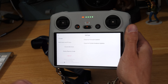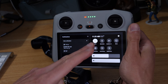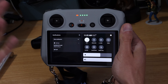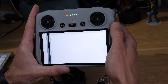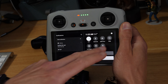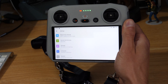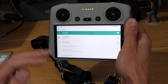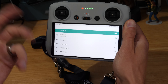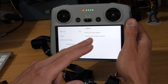You can see it says 'network connection required,' so to do this we're going to need to jump into the top menu and switch on Wi-Fi. You might find it just comes up with a question mark. When you initially set up your remote you had to do this, and it may be that you're on a different Wi-Fi connection now. Hit the cog up in the top corner, come into Network and Internet — it's just the same as using an Android phone. Jump into Wi-Fi; you can see I'm connected. If you need to re-authenticate a network you can do it all in here, and then once you've got an active connection we can come back.